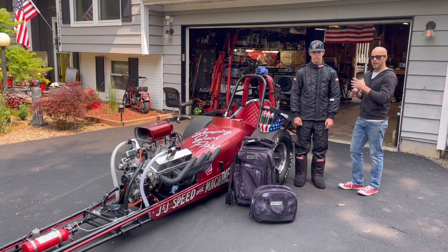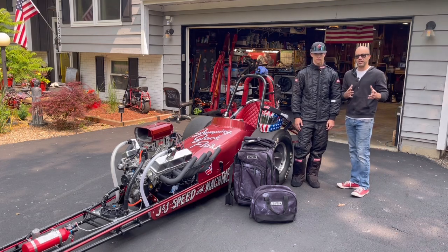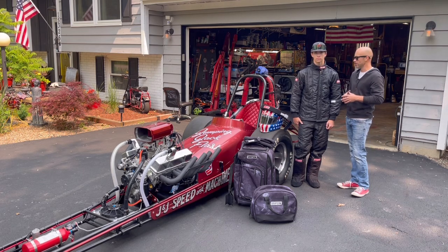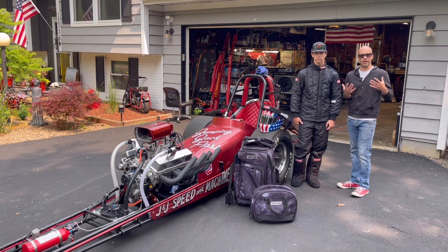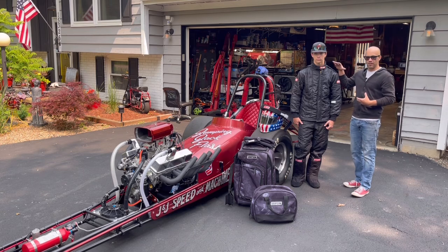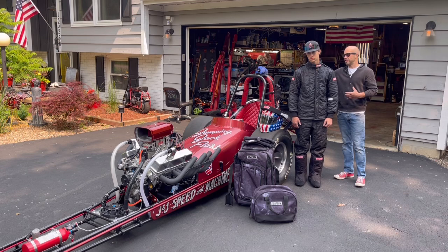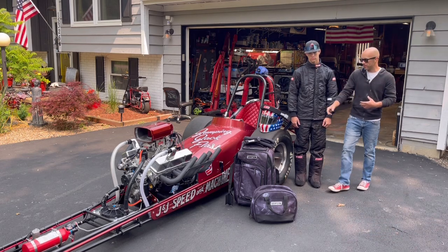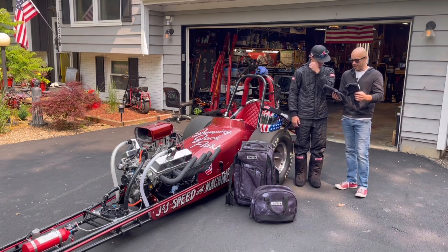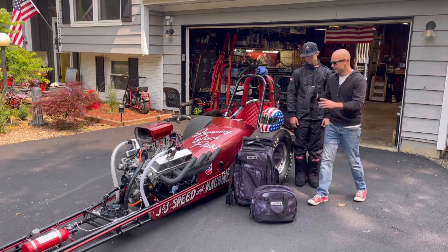Now, I'm going to put a link in the description on what all the SFI ratings mean, but when I talked to IHRA and I looked at all their different classes and I looked at their specs and their safety regulations and rules, what I was able to do is match what was needed for the safety gear to what's going to be needed. So, like I said, he's got RaceQuip jacket and pants, and the rating on those is SFI 3.2A/15. The Simpson boots and the Simpson gloves, which are right here, these are SFI 3.3/20.